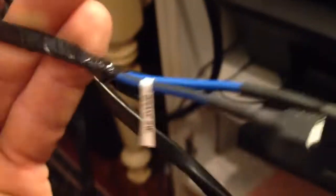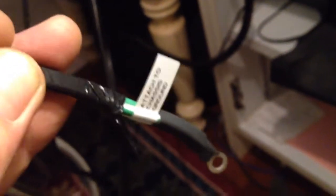For the dash, the lead drops straight down and the first thing that breaks out is this long one for your horn. There's two wires — one's going to be labeled horn, that's one of the power leads. The other one goes through it and back to the switch where it grounds later on. Also dropping out on this is the brake switch. There are two leads: the one that's labeled is hot; the other one goes through the switch whenever you put your foot on the pedal. Here's the other ground hooked to the chassis — it services all the dash grounds.